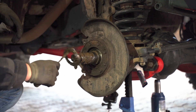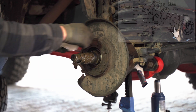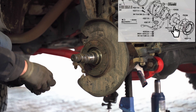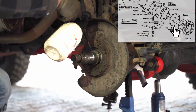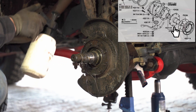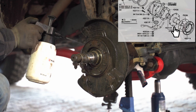Now we are faced with the spindle — the part we are cleaning now is called the spindle. The bearings and the complete hub assembly rested on the spindle. Just wipe it down first, then use some solvent to clean up everything, so you have a clean place to work. If everything is greasy with sand or mud, that's no place to work.